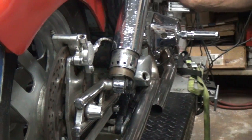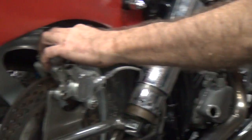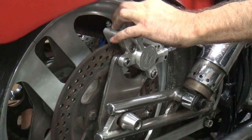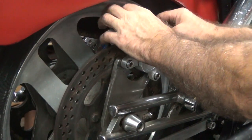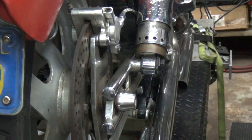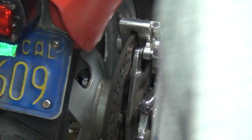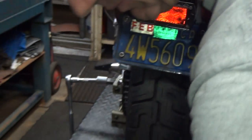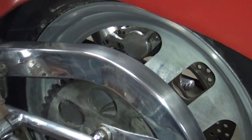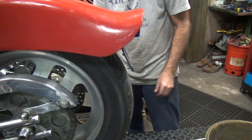Appreciate that. They said this didn't work very well for some reason. They're right. Doesn't work at all. Doesn't move. Now, what do you think it's going to take to make that work? Rotors and pads? Bleed? I can't guarantee it needs to bleed. Probably needs rotors and pads too.